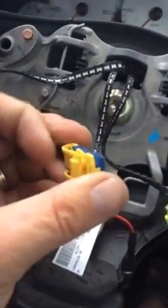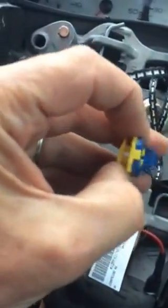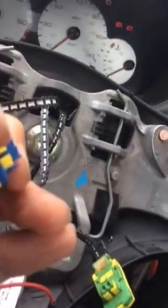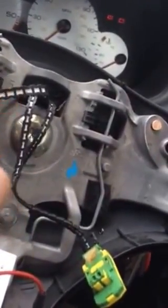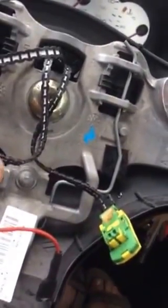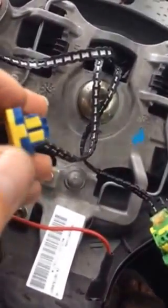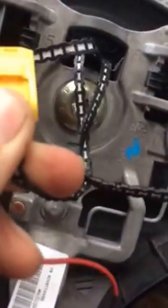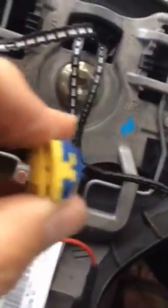Just for your information, the connectors have a locking tab — there's a clip at the side and a tab that pushes these tabs out and locks it into place so it won't fall out. There are also two little yellow tabs here which, when you push the connector in, push a shorting bar away on the airbag so that when you take this plug out the two pins get shorted out — so you can't accidentally set the airbag off with static. To get those plugs out you have to get a screwdriver into the back and pop that out first.